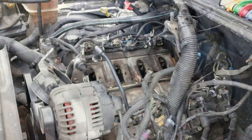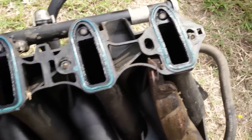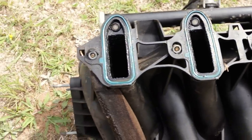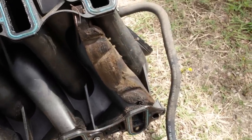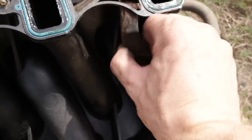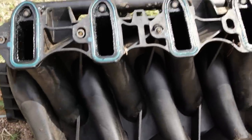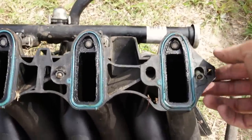And we can finally get in here to our knock sensors. Moving to the intake manifold, you can see the silicone on the intake manifold runner gaskets is crushed and it's not gonna spring forward. Here is the foam rubber blocks I was talking about. We need to go ahead and remove these and throw them away because they keep moisture from getting out once they get in, rather than preventing moisture from getting in as GM initially intended them to.